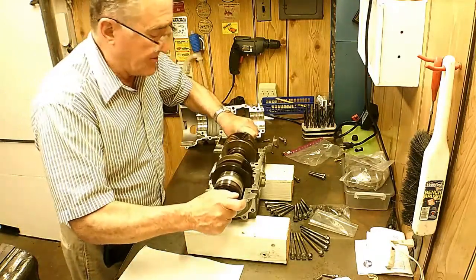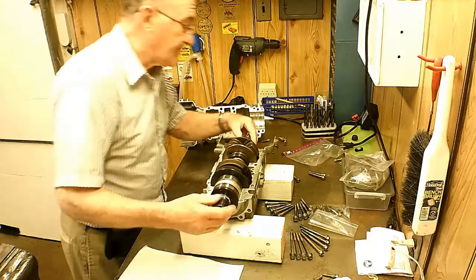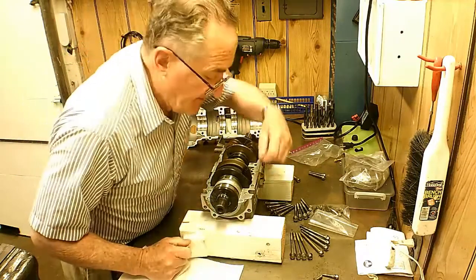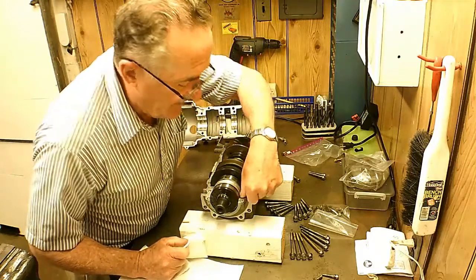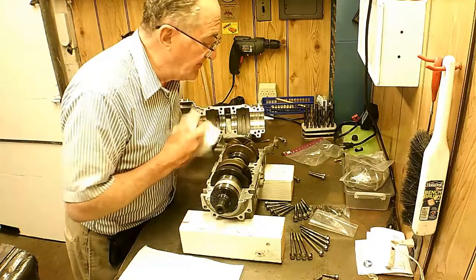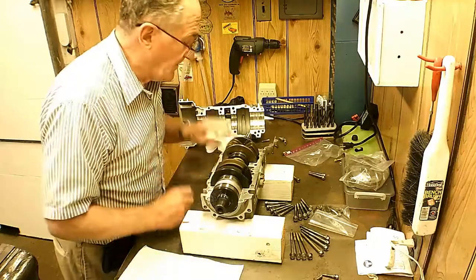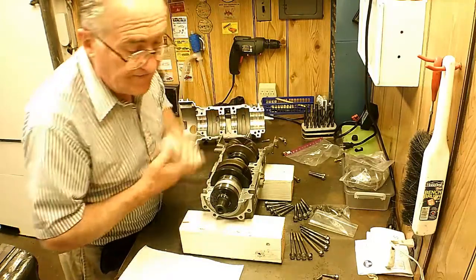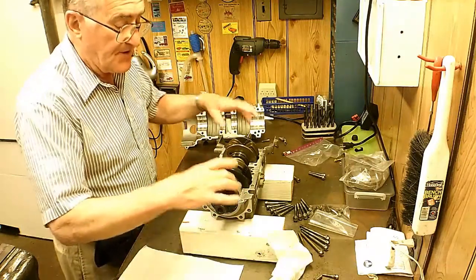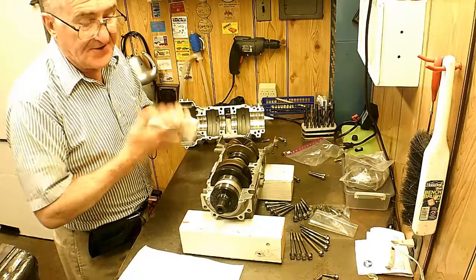The point I was trying to make — I'm going to set that down in there — is there's a little bit of relief where these rubber seals are, and that was just done by hand. When you look at it you'll see they're all different depths. Somebody went along before they assembled it and used a little Dremel tool, a little hand grinder, to relieve that right there. Because when the halves come together on the crankcase, it's going to bunch up that rubber, kind of squish it up and make a little bulge right there. So that's why they relieved it.